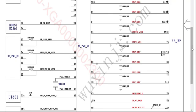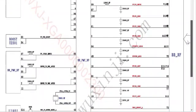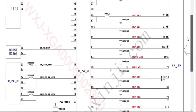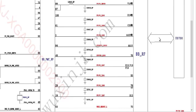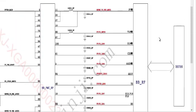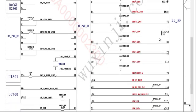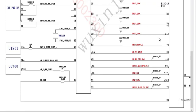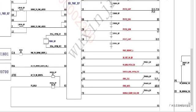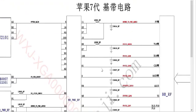The BBPMU gives biasing voltage to the BB CPU. When the BB CPU does not get the buffer voltage, then a baseband-related error appears. Due to the baseband error, the phone cannot be activated in iPhone 7. In this case, it shows no network.